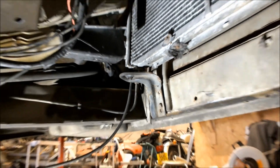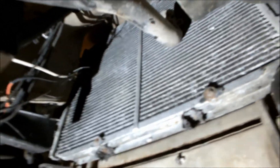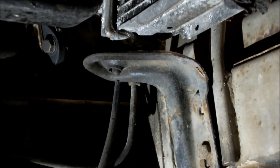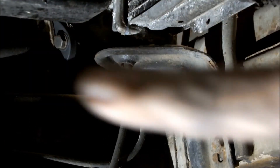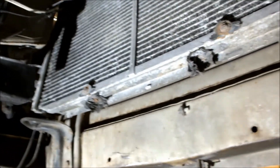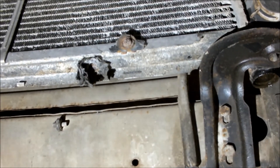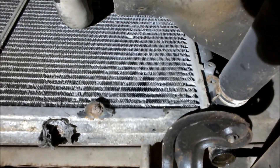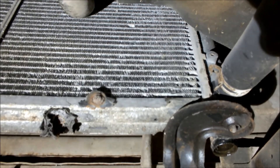So we're underneath the van now. This is going to be a very short clip because you can't really see anything. But there's the radiator as it's sitting in the van — this is behind the front panel. If I zoom in over there, that's one bracket — you can see the two bolts, one and two just there. And then you've basically got the same on the other end — one and two. Before I started the video I actually disconnected one of the coolant pipes. Looking at it, they should come down on the radiator — they just sit up there so that shouldn't be a big deal.